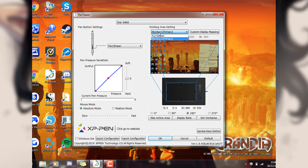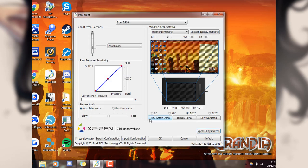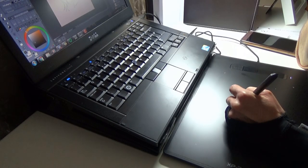Within the XP-Pen software you can adjust the working area to fit your screen dimensions, change your pressure sensitivity settings, alter the function of the shortcut keys on the pen or the tablet, turn Windows Ink on or off, and choose left-handed or right-handed mode. I'm left-handed and it stayed on the left-handed setting with the express keys on the right, and it kept that setting when I turned the computer off and on again — something that some other brands including Wacom have actually failed at.